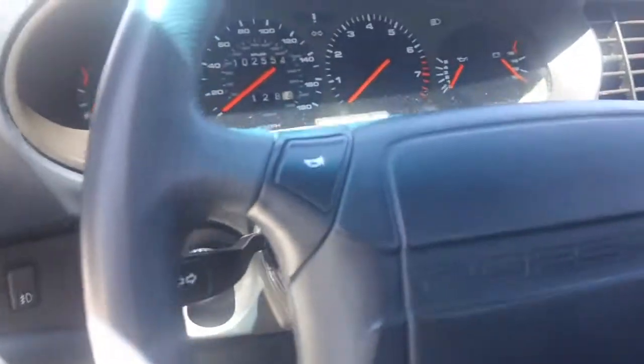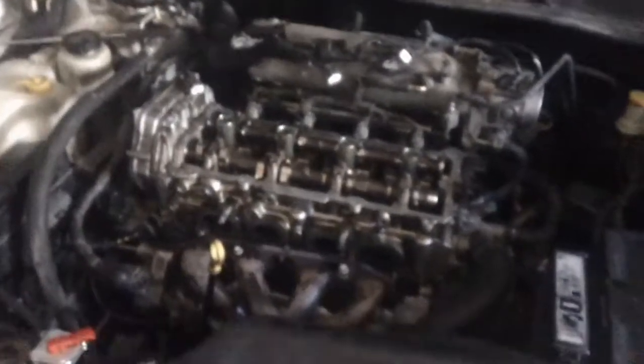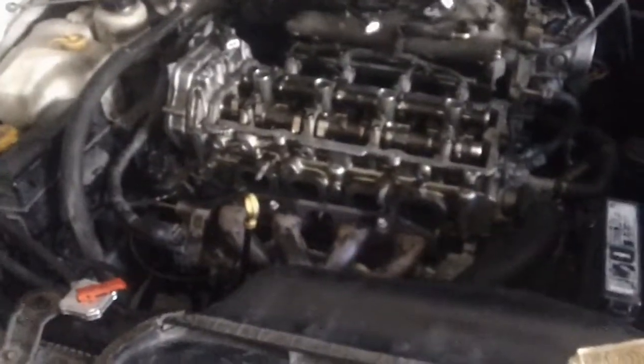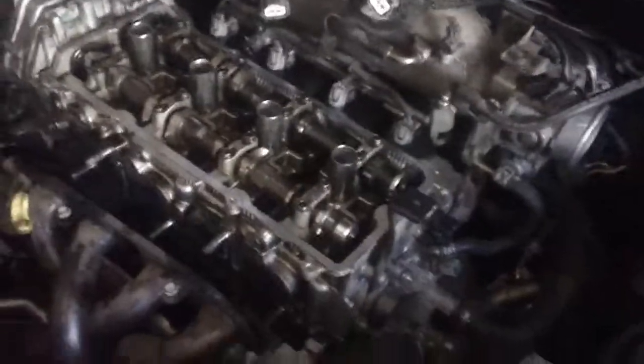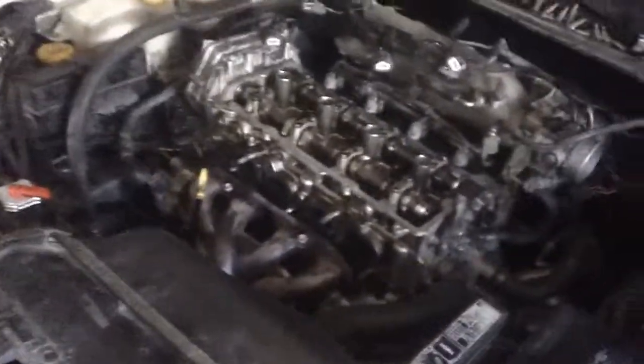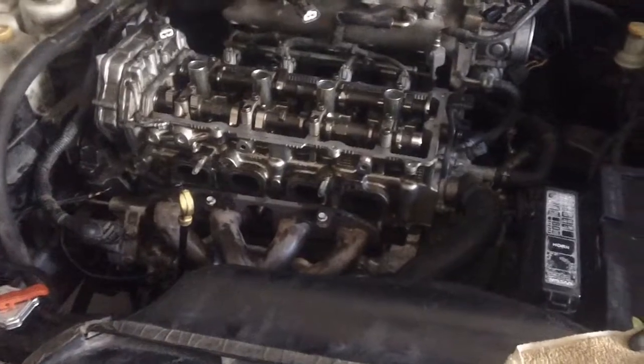He says there's some dust inside the lens now and he wants me to take it apart again — but I've got other projects to do. Currently I had to get his car out of the garage because I'm working on a 2002 Nissan for a couple's teenager kid. Typical with these cars, the head gasket goes. I'm in the process of tearing it down to get the head off and send it to the machine shop. I still need to remove the thermostat housing, intake manifold, timing cover, and line up the timing marks. I think I may have to take the cams off too — it's been a long time since I've used a machine shop, and I don't do a whole lot of head gaskets.